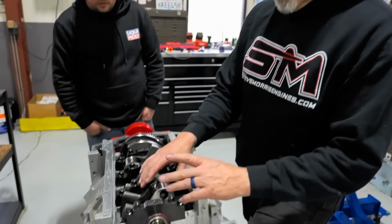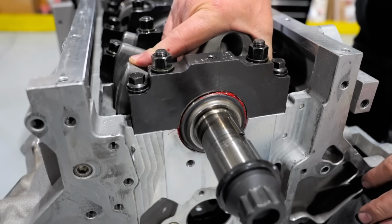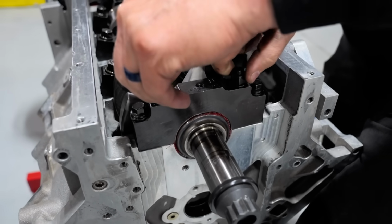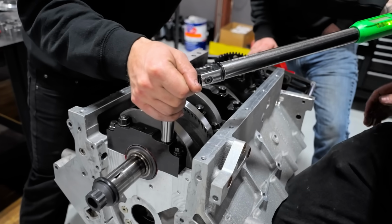You will occasionally find this out, and this is why things all have to be torqued in order. When we run things through the line hone, everything is torqued, because when things get untorqued, they relax or go back to some kind of natural state. So we took the cap off and looked at it. It is touching the bearing here on the parting lines. But the cap is registered tight, with a dowel pin. This thing is tighter than heck. These are loose. Okay, Kyle, start tightening this up, and I'll be sitting here with my hand on it. See, that gets better already. Better. All right.